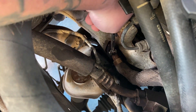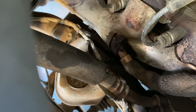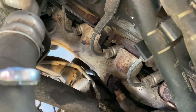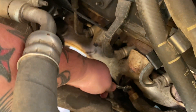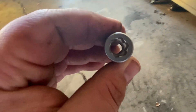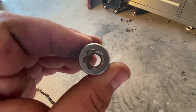Next, you've got two 10 millimeter bolts down here on the exhaust manifold. They're pretty tight so you pretty much have to use an open-end box wrench. I soaked these while the truck was cooling down with Kroil. You definitely don't want them breaking off because you do have to put a block-off plate on there using the same bolt holes. As a precautionary step, I'm using a 10 millimeter bolt extractor socket — it has teeth that bite in, since these bolts are known for stripping out and I really don't want to deal with that.